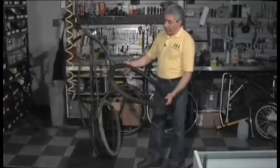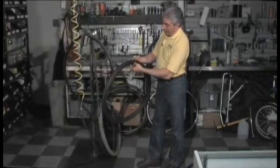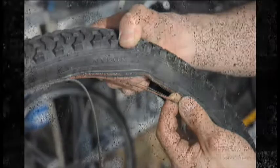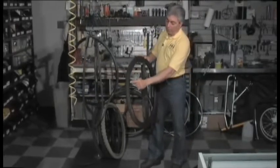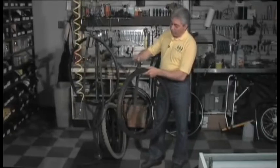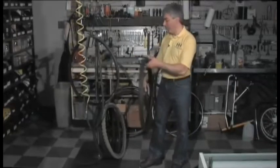This one is a damaged bead. Tires have metal beads inside that hold it onto the rim, and this bead, through overinflation, has caused the tire to rip away from the metal bead. So that inner tube blowout I showed you earlier — when this fabric tore away from that metal bead, it happened quickly. The inner tube pushed through that opening and the air pressure caused it to blow out. So if you see a separation of bead from tire, that has to be replaced.